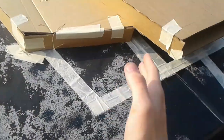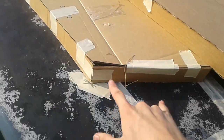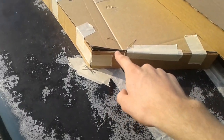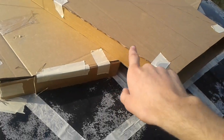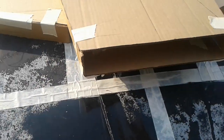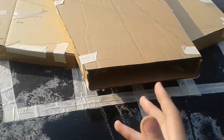So I'm going to shorten this to give me some of those inches back. I'm going to take a half inch off here to make it 1.5 inches, and then take a half inch off here and make it 1.5 inches. Lower this entire thing down to 3, and the top of this will probably be sitting right about 4.